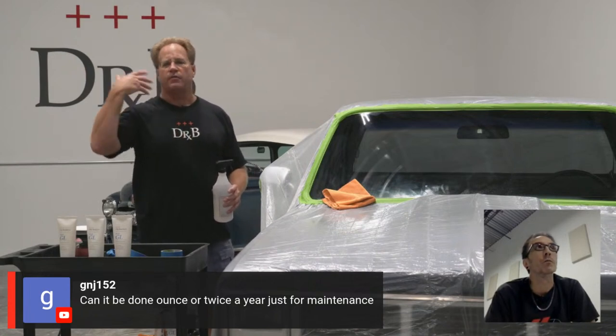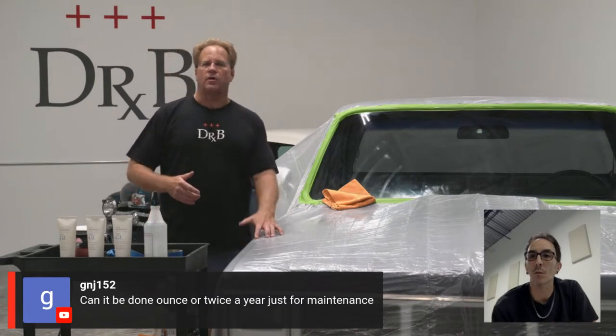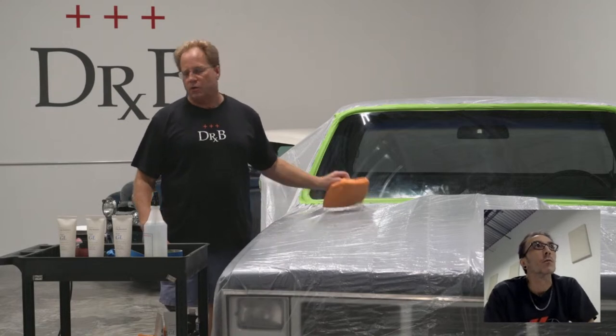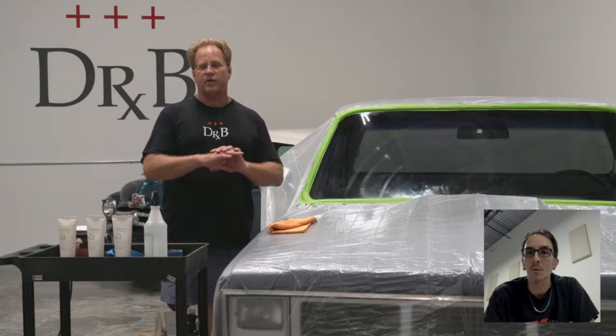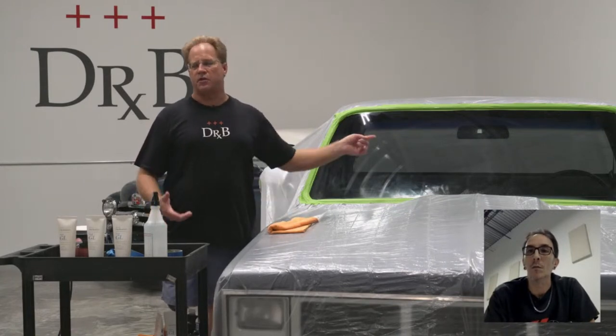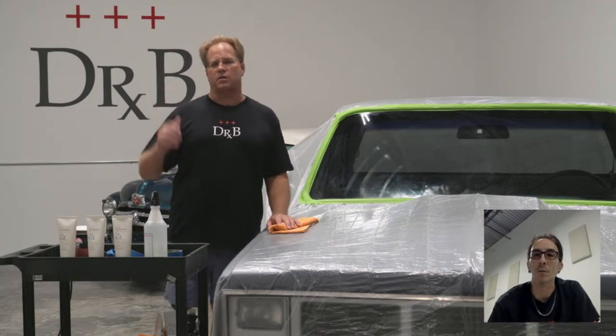water drizzles down every time it rains or gets wet. And those types of things don't wash off, okay? So it builds up on the glass, builds up on the paint, builds up on the glass. So you can use this polish for both topical glass polishing to get that glass perfectly clean, or for subsurface glass polishing to remove below surface defects like swirls, scratches, and wiper marks like we just did here.